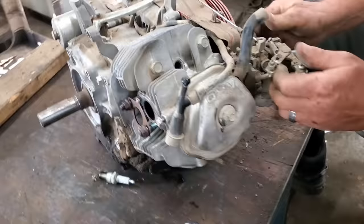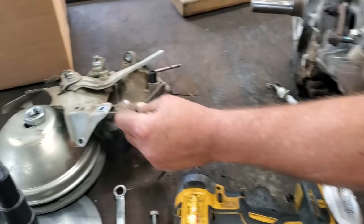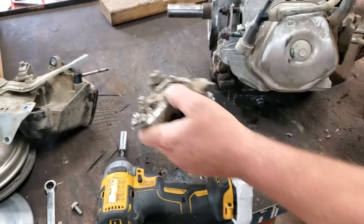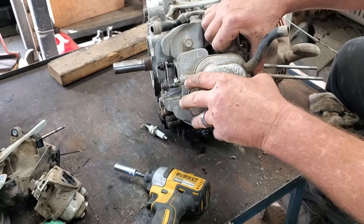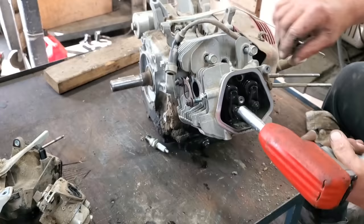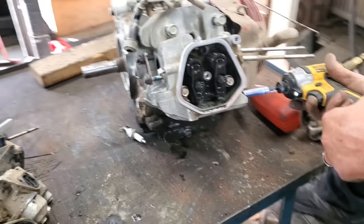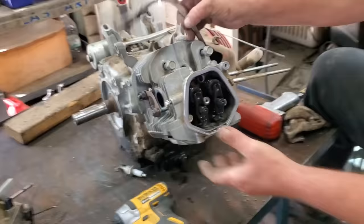Really simple, folks. These little bolts — don't lose them, they come out of this air cleaner spacer. Be careful you don't crack your spacer plate. A 10, 12, and a 14 — you can just about take anything apart on one of these. I'm already down in here. I'm going to blow the head. The only thing I did before we pulled the engine was take the muffler off, because that was about 30 pounds.